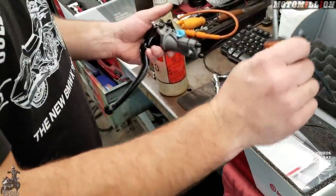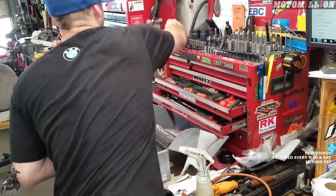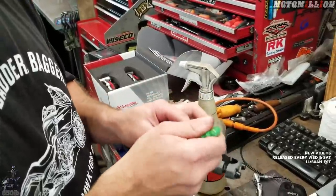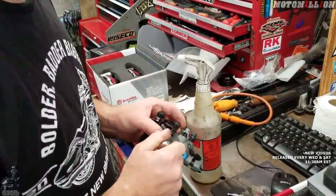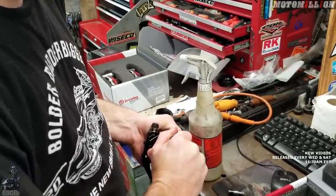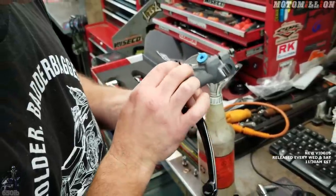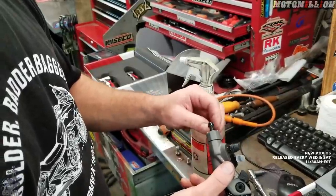The BMW uses pressure sensors in the ABS box to tell the brake light to come on, so we don't need the switch and can remove it — saving a few grams of weight. Let's see if this new master cylinder fits our handlebar — that'll be step number one. It fits. And step two: we'll fit this loosely and check how the brake line is going to fit in the bottom.